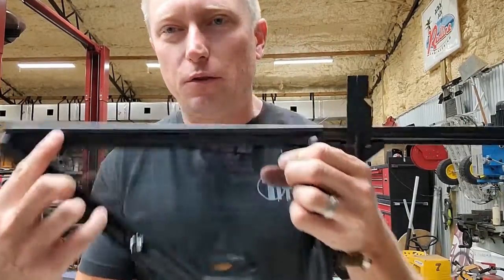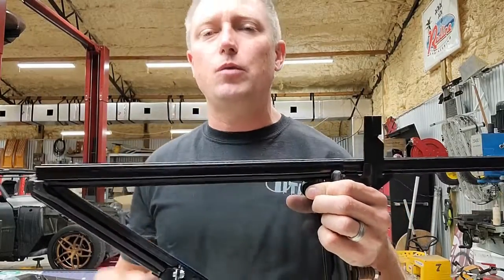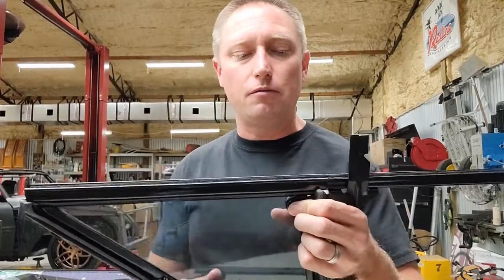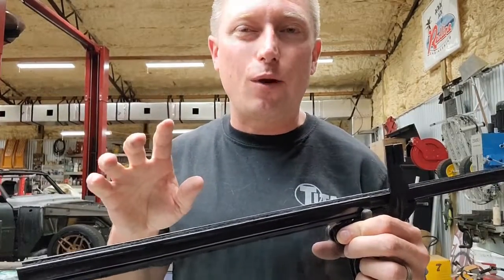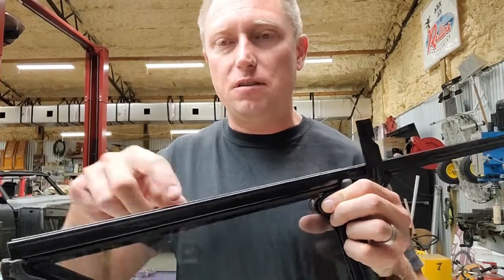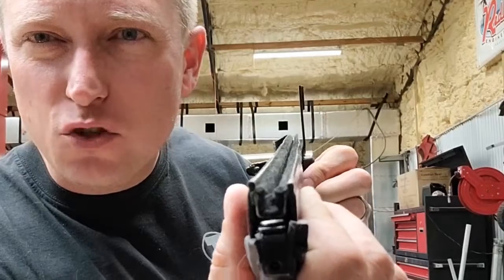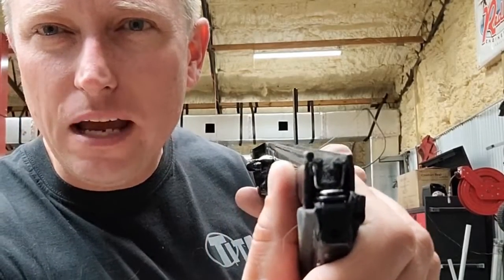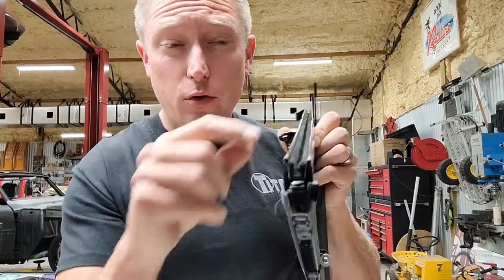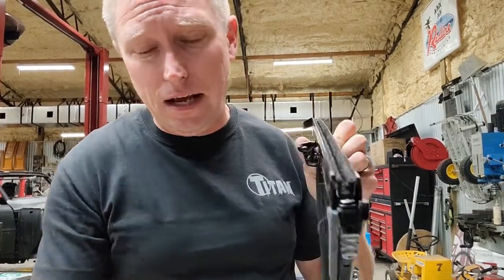Be very careful in that you've got this stainless steel trim that goes down the side of the vent windows. And naturally, this applies to lots of other cars, not just my 67 Nova. Watch out for how that stainless steel trim interferes with that fuzzy, because if you'll notice, the stainless trim kind of wraps around the edge and holds the fuzzy in place. So if you were to put this trim on there and then start trying to hammer the fuzzy in there, it ain't gonna go well.